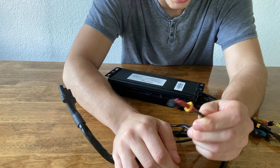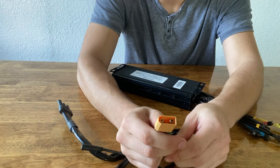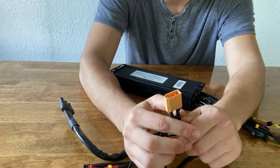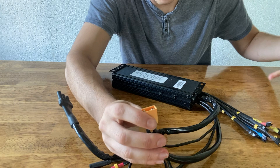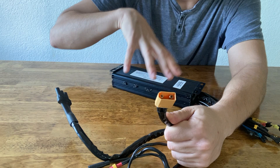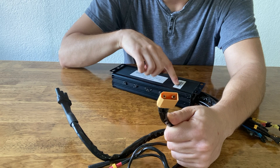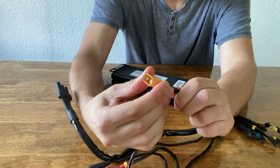After the motor wires, you're looking at the power wire — this goes to the battery. This is an XT90 connection, which is more than enough to handle even our 8,000-watt systems. We have ones with pre-charge built in, so if you plug it into the controller it's not going to send a big spark. Without pre-charge, it'll cause a big spark when you plug your battery into a dead controller, because the battery voltage is way higher and it instantly wants to charge up the MOSFETs. Eventually you'd end up destroying your connection. That's why we use the pre-charge and high-end XT90s.